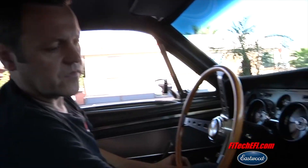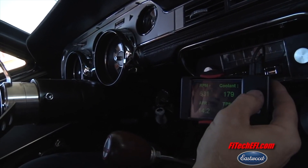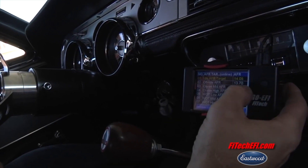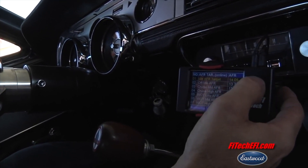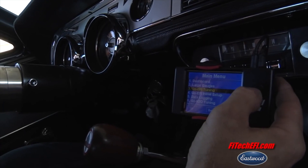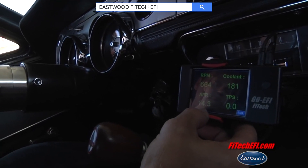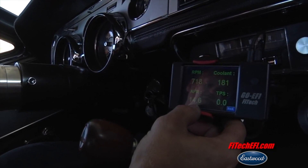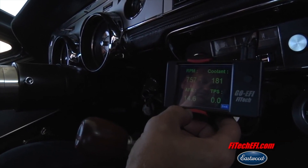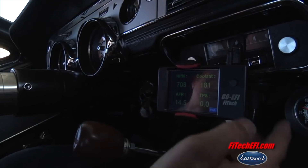If you look here, we're idling at 14.2. If I go back to tuning and look at the air-fuel targets, we're set to run at 14.05 air-fuel ratio — that's what we're targeting at idle. Looking at the large gauges, we're running right at 14 to 1, just bouncing right around there. It's got a lot of cam overlap, so that's what you'd expect — just hovering right around there. That's awesome for a car with a cam like this to be running like that with a nice low idle.